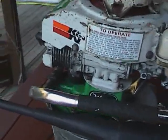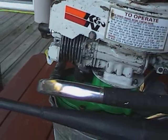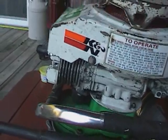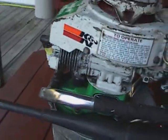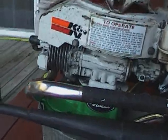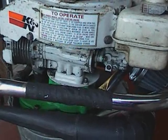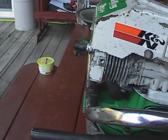When I had her apart, I did some port work in the cylinder — opened up the exhaust better than it was. It's got kind of an odd design; they basically just drilled all the ports in there. You can see the little caps where they plugged the transfers. I didn't get too crazy — there's a lot more I can do later if she ain't fast enough. I also opened up the reed cage and used a high compression head gasket on it.